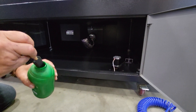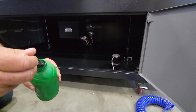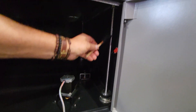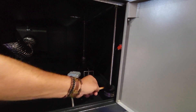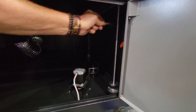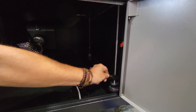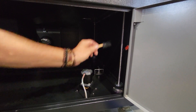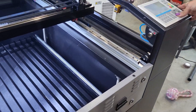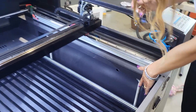Open your bottom doors in the front. We're going to soak our foam brush with oil again and run it down your ball screws, getting a good amount of oil in there. Do this on all four ball screws — the back ones are a little bit hard to get at, but you can do it. If you just come over to your table and lower the Z table, it gives easy access to all four ball screws.